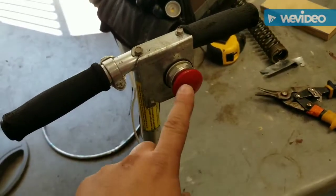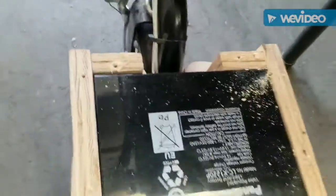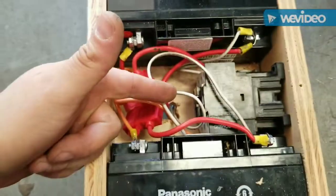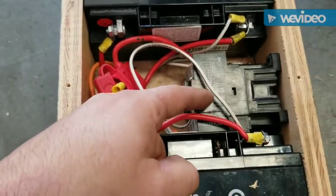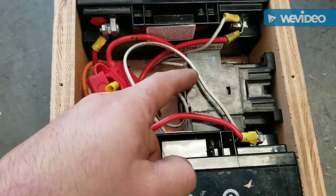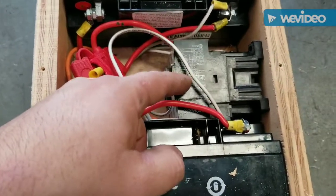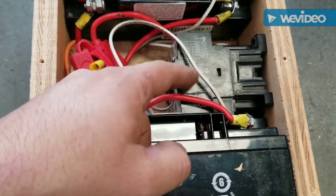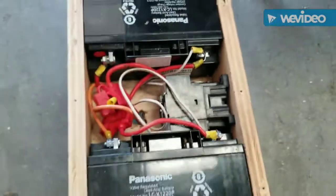Okay, boys and girls, just about done. So we got a nice big push button. We got two number 12s going down, coming across, they go underneath the white guys. They come up. I got 12 volts, and it goes to a coil. Now, the contactor, 24 volts. I'm sorry. Yeah, 24 volts, AC, field coil, operates on DC. Learn something new every time I do one of these stupid projects.